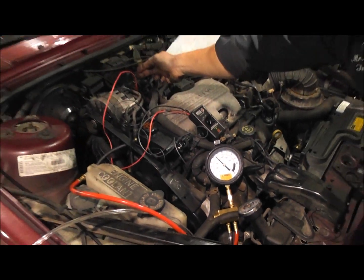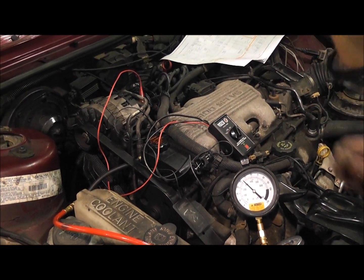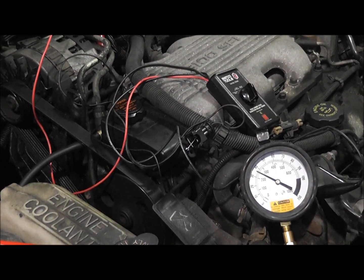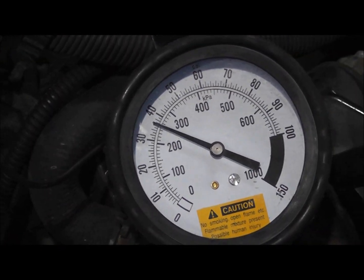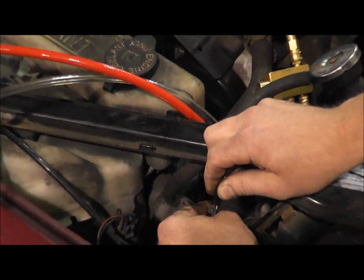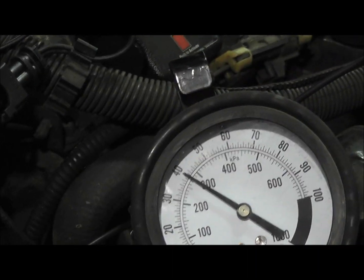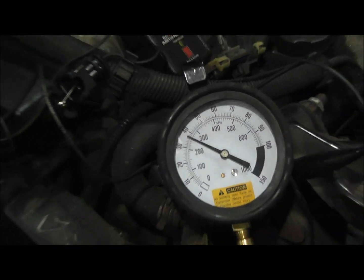We're already connected to number one with the timer tool. Starting at 43 PSI and holding, I hit the button — the injector pulses and that dropped down to about 37 PSI. So remember those numbers: 43 starting, 37 on the drop. We'll do each one twice just to be sure, but not more than twice or we risk flooding the cylinder and causing a hydro-lock condition. Second pulse: 43 down to 37 again.